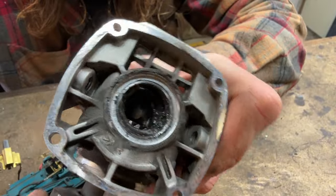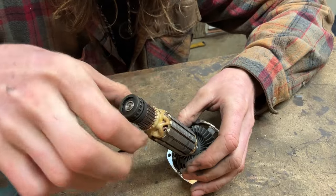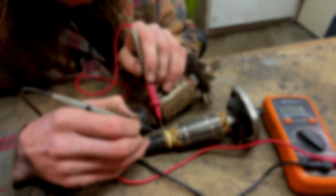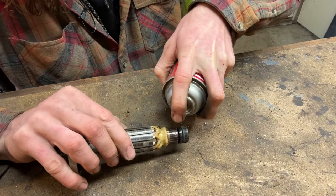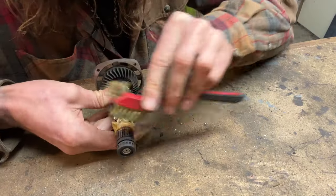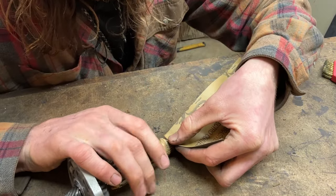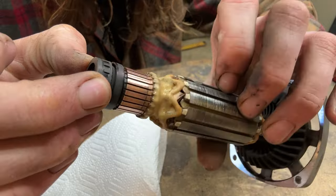All right, there's our head. Looks okay. Yeah, that is toasty. I don't see any cracked epoxy on these stators. All right, we've got our friend QD electronics cleaner — give that a spray on those surfaces. Let's give it a light scrub down with our brass brush. Maybe I'll take some six or eight hundred grit sandpaper to those. Here's some one thousand. Our super quick lick with that one thousand grit sandpaper seems to have cleaned those up nicely.